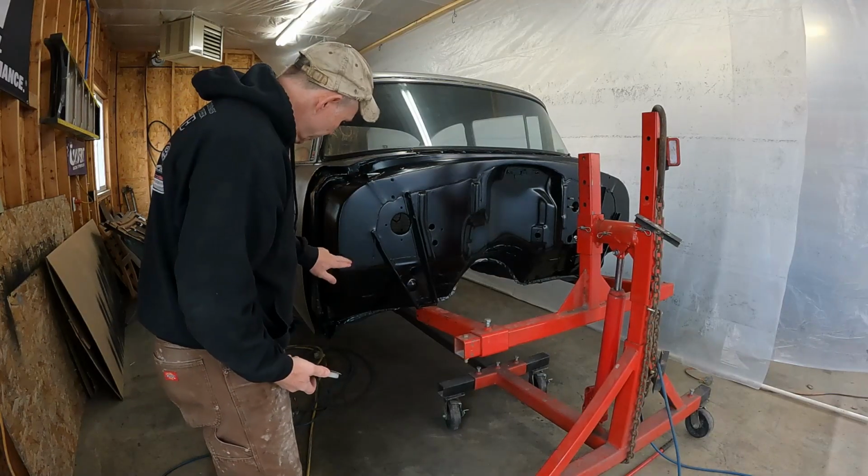But yeah, I'm just gonna sand block it with like some 180, then hit it with some 220 or something, blow it all off, hit it with some wax and grease remover, spray it again. So let's get to it. I'm going to start with this spot right here.